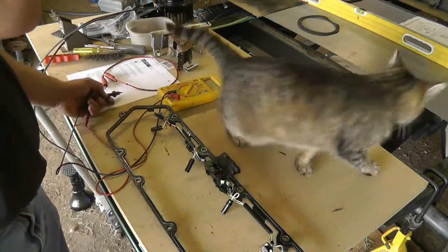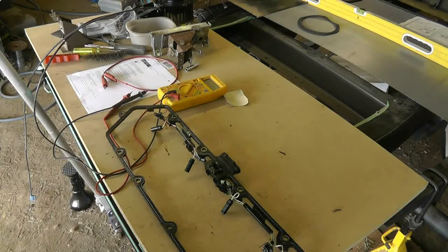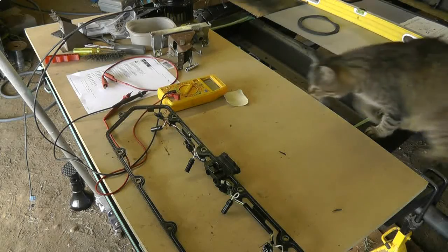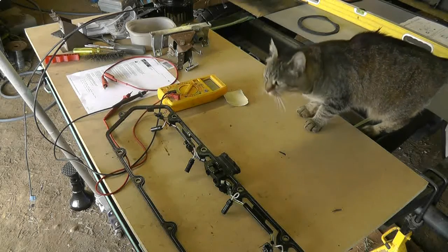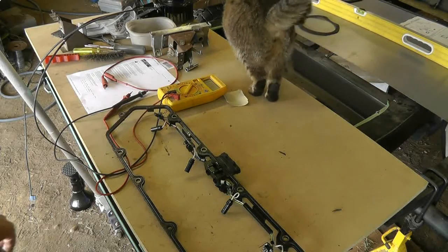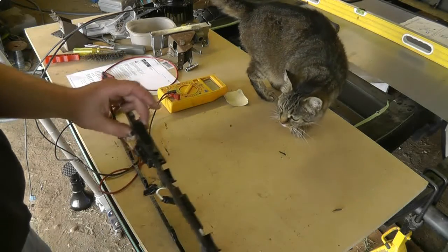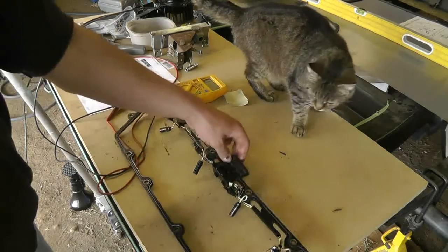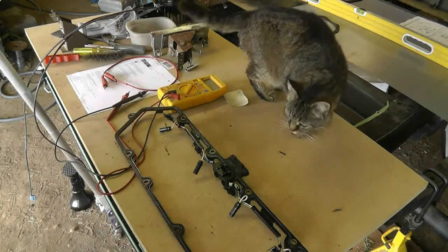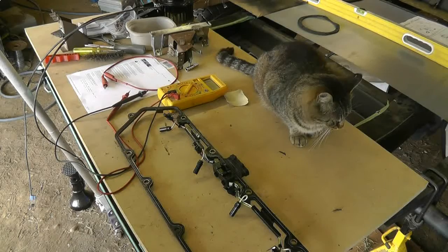Now you can do the tests inside the vehicle. I'm going to go and grab a fuel injector — actually, I do have some fuel injectors lying around. I'll grab a glow plug, and I'll just tell you what the resistances are. You can wring it all out from here — what the resistances are — and it'll tell you if there's a break in the harness or if you have a bad glow plug as well.